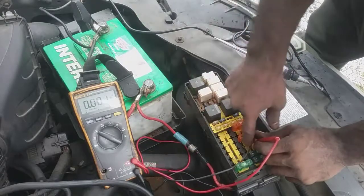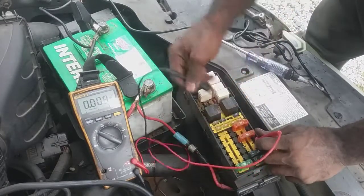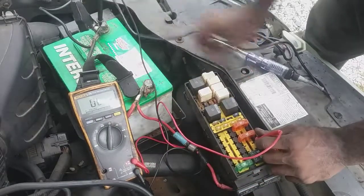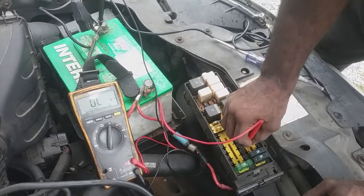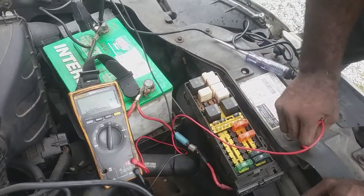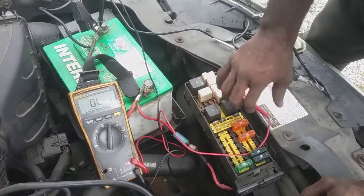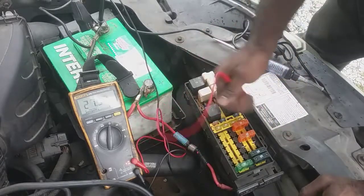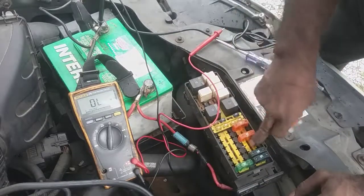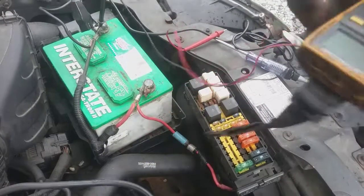There's another way to check this if there was any type of short circuit, which is to do a resistance test and simply put it on a little horseshoe thing, go to ground, and test each side here and see if any is being pulled to ground. If it was pulled to ground, you would get a value like this. Yeah, 5 megohms. So something insignificant. Other than that, we got our fuse. We found the blown fuse. So put everything in here. Everything should work like normal inside the car.